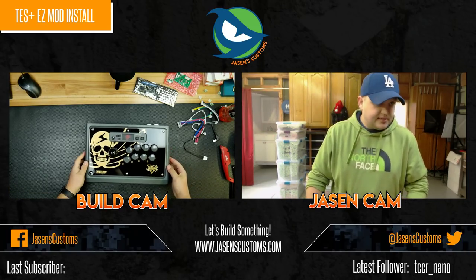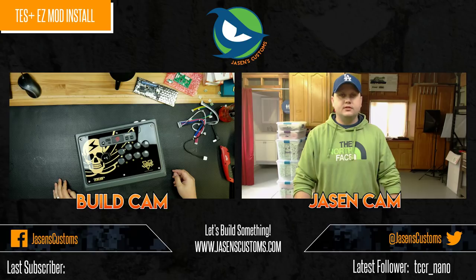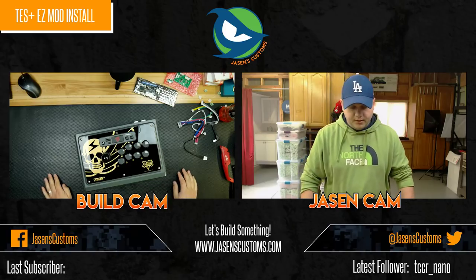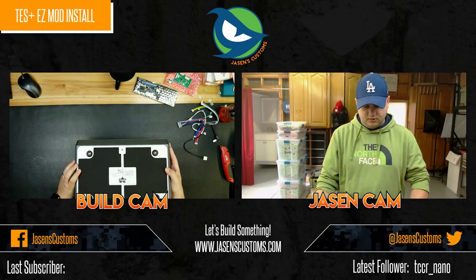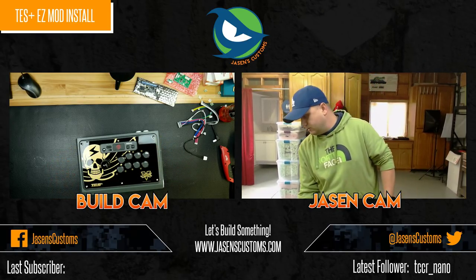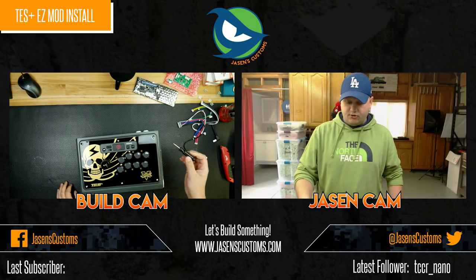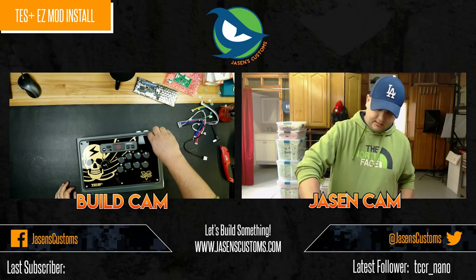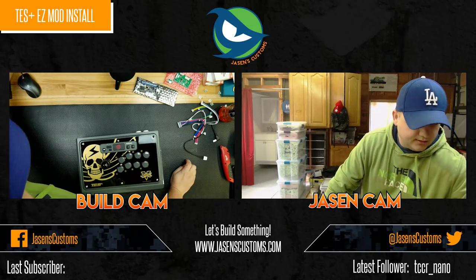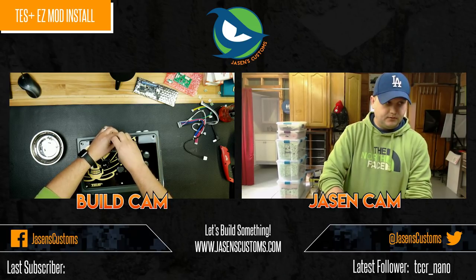Okay, so this is actually not a hard process to do, but it is a little bit more complex than the TE2 or the TE2 Plus or the Panthera, etc., where you just pop a button, this whole thing opens, and you have lots of room to work. We are going to need to do this in two parts. There's a bottom part and a top part. So we're going to take the top panel off first, and to do that, you will need some Allen wrenches. Fortunately, I have my Mad Catz screwdriver here, and conveniently, it uses the exact same size screws. So we're gonna just go ahead and remove these like so.